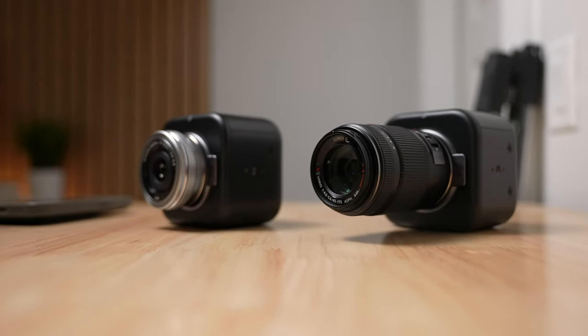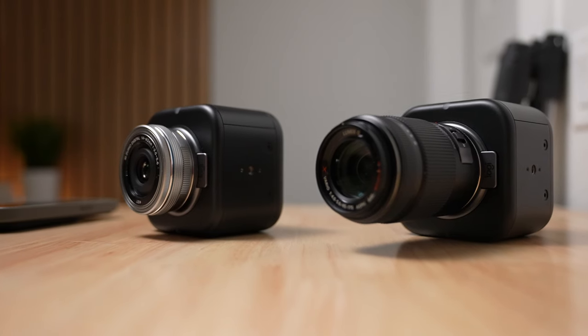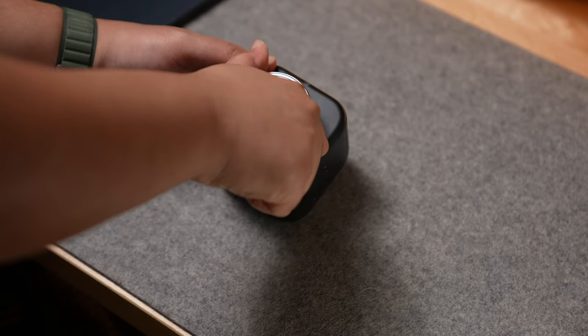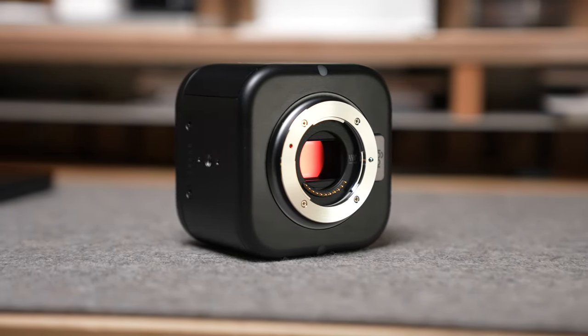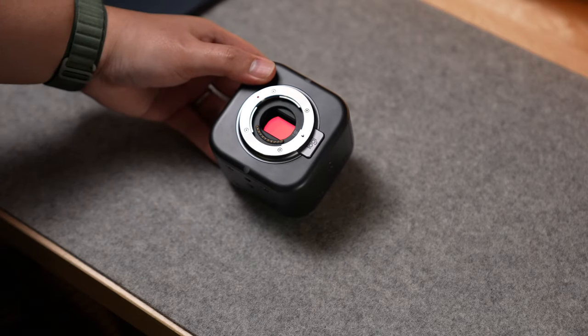Let's talk about the camera itself. The Mevo Core supports interchangeable lenses, which means you can purchase lenses used on other cameras and mount them on the Mevo Core, or change how an image looks without being forced to a fixed lens like you would with a webcam or action camera. It uses a Micro Four Thirds sensor and lens mount, enabling you to switch to other Micro Four Thirds lenses made by other manufacturers, taking in more light than tiny webcam or phone sensors, making them less noisy in lower light environments and leading to clearer images.